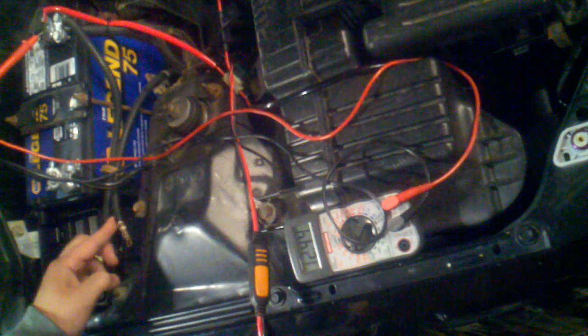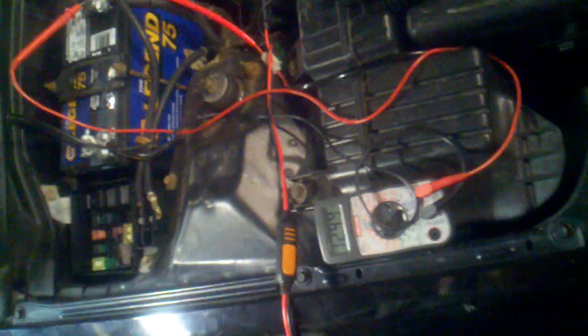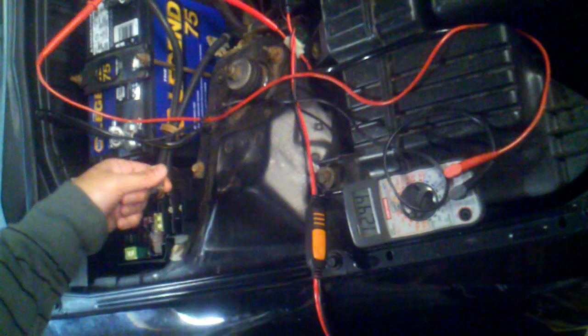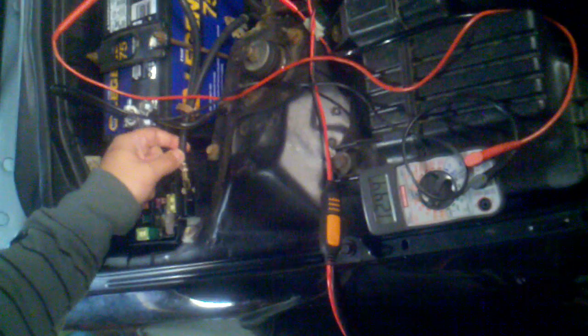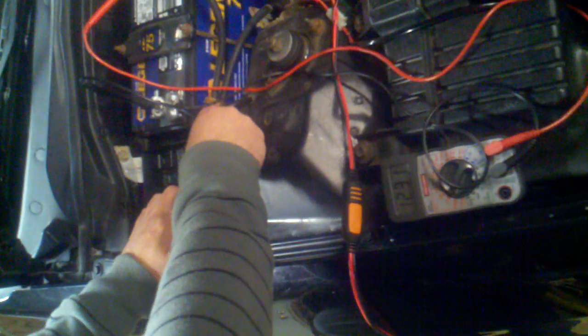The weird thing I've come upon is that after testing the actual battery voltage to see if there are any drops, it stayed at a steady 12.42 to 12.44 volts just fine. The wire right here comes directly from the alternator, which charges the battery. Once we connect it to where it's supposed to go — considering this is really one of the last options as far as identifying the culprit — we start seeing the voltage drop.